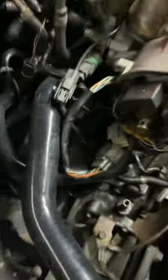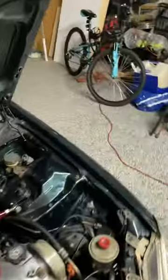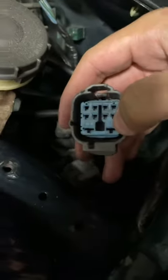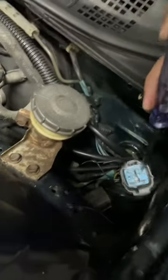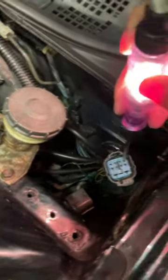If you go back to plug C101 right here — let me disconnect it real quick. C101 disconnected. I should have a power source here coming from the fuse box for ignition, and there's nothing. The key is turned on, so you can see we have power up here, but down here we have no power.